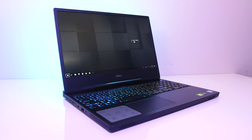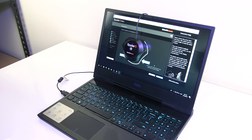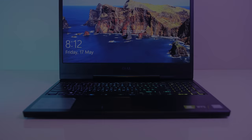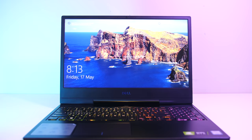The 15.6 inch 1080p 60Hz screen has a matte finish — no G-Sync available here, but the G7 is also available with a 144Hz option. I measured the color gamut using the Spyder 5 Pro, returning 97% of sRGB, 68% of NTSC, and 73% of AdobeRGB. At 100% brightness in the center I measured 298 nits with a 930:1 contrast ratio, decent results for a gaming laptop and noticeably better than the G5 I recently tested. Backlight bleed seemed okay too — the bottom section towards the right was only just barely noticeable in this worst case scenario, though this will vary between laptops and panels.